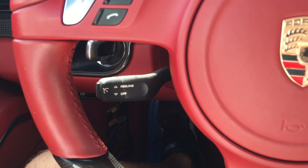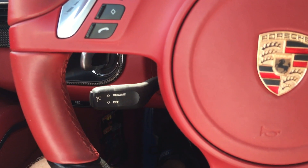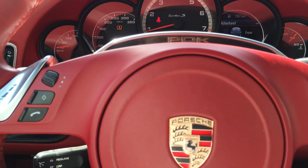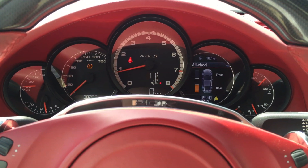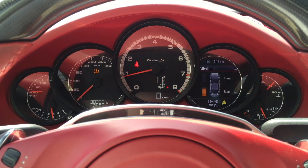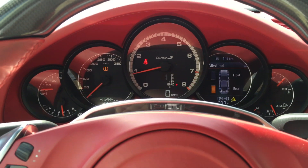The cruise control switch, as with many of our kits, is used for map up and down. Cruise control does still work for holding a set speed — as long as your pedal position is within a certain threshold and the RPM is stable. To change maps, use the cruise up and down button. Some people asked if we could make the tacho change to show the map you're in, but experimenting with that messes with the transmission ECU, which reads the RPM signal from the engine ECU — the same signal used for the dash — and manipulating it throws a code in the transmission ECU.